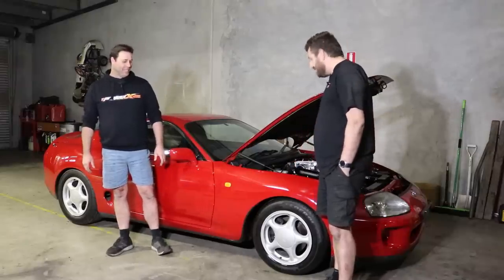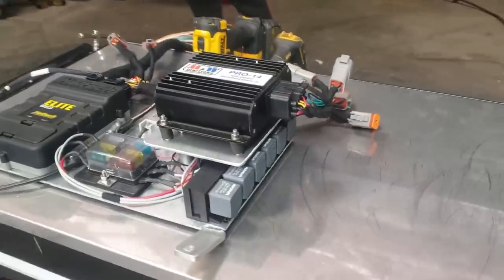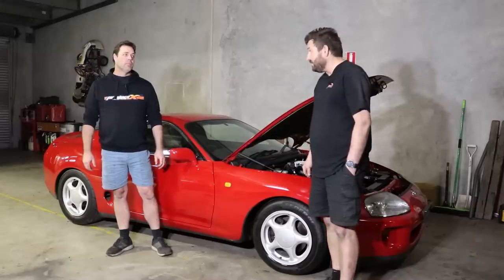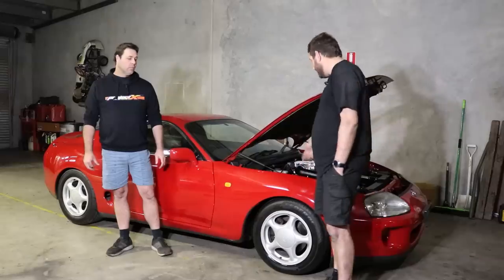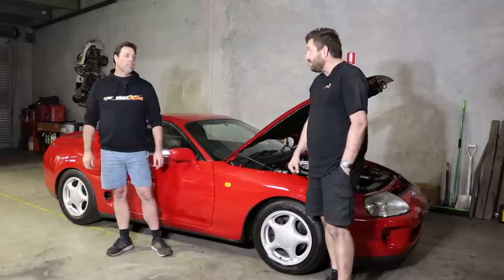I'm not relying on the coils to do the work on their own. They're actually not even working as a coil. I'm using an M&W 140 odd millijoule CDI box, just hammering voltage. That's why I had to use the special grounded proper wiring for it, because otherwise everything will go chaos with the 80,000 volts that are going down that line.